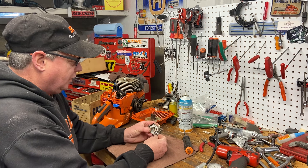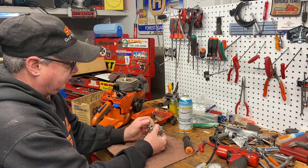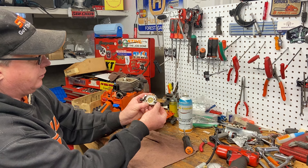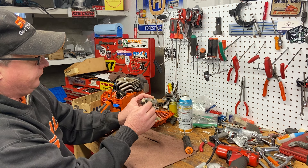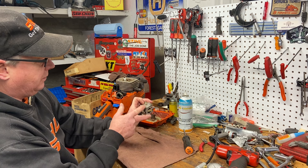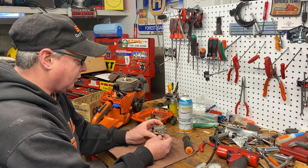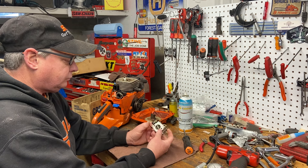One thing I've already noticed is the fast idle plastic piece — the notches are worn off. So if your fast idle isn't working after you push the choke in and it's not sticking, you need to either replace this plastic piece or cut a couple of grooves along it so it grabs again. I'll try that after we check it out. I'll do a quick zip with my little zip saw.